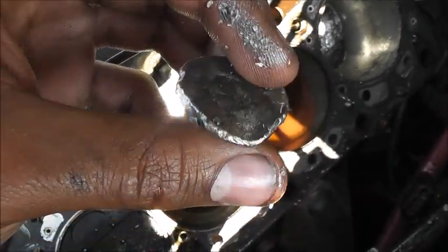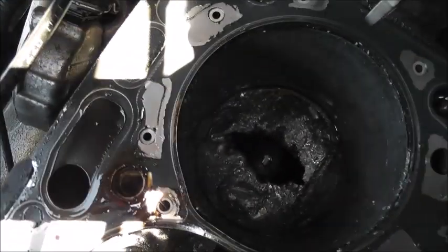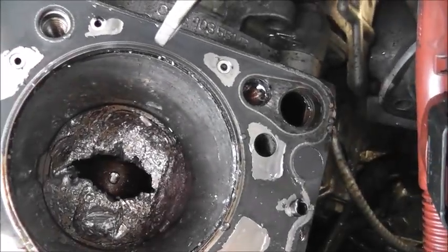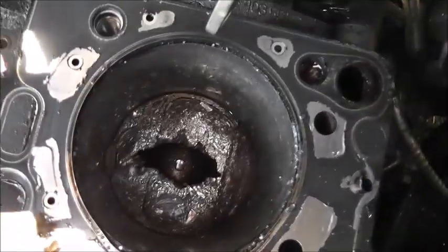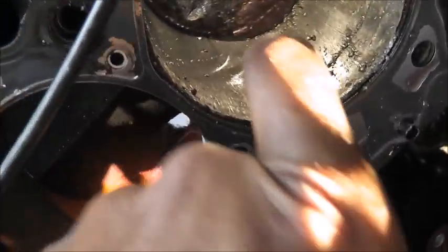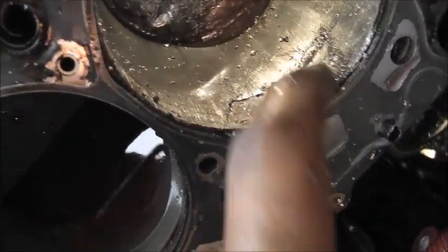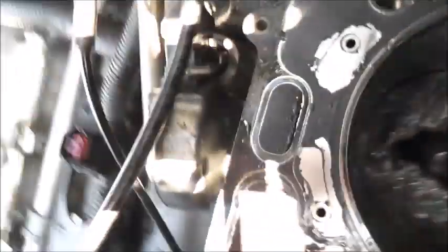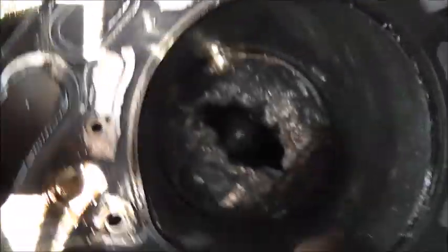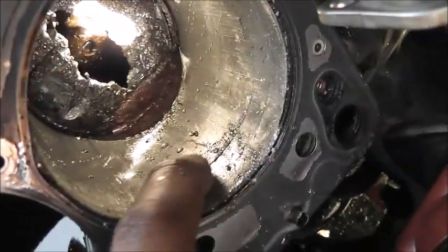It's quite heavy for a little valve. And an absolutely battered piston. We can see here there is a bit of scoring on the wall here — gouging. I don't know what it's like on this side, maybe it's the same also.